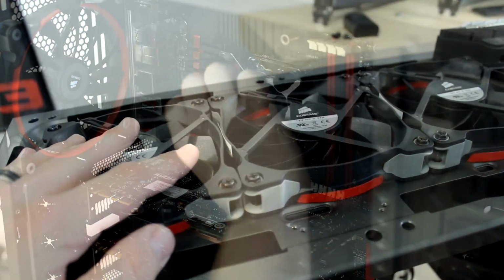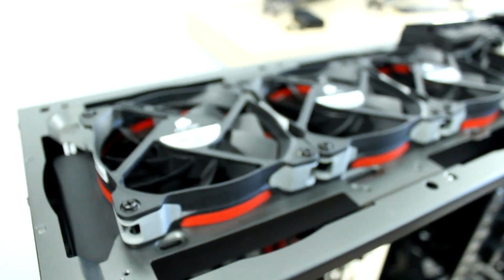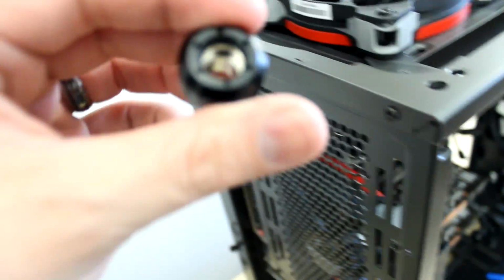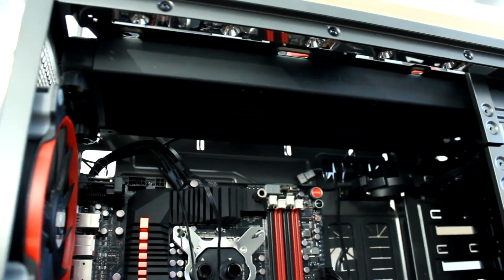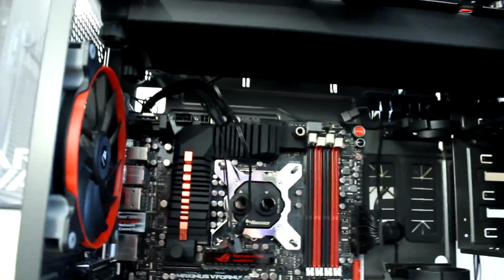One thing I want to point out that I did here is I moved the fans to the top and the radiator to the bottom, because the way the 820 is, it's got these little cutouts here for the fittings, but because of the size and how big these fittings are, they wouldn't really fit right there. Not to mention I wouldn't be able to tighten them down very good for the sake of the acrylic tubing. So now up underneath it, the entire radiator is visible. So I think that's going to look alright.